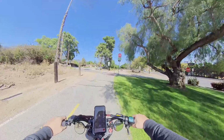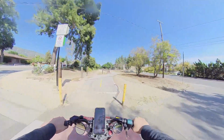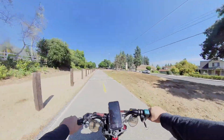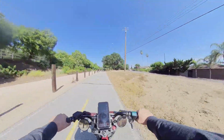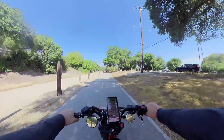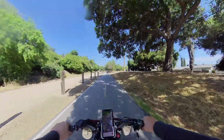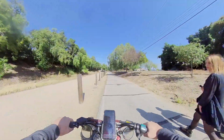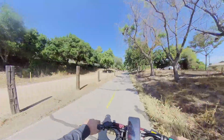This setup was first on my Arielrider X-Class 52 volt. I went around 20 miles testing it on the Arielrider. The BMS on my Arielrider 72 volt battery was only 30 to 40 amp, so that's why I wanted to pair it with this 60 amp. And I think that's what made the 8 mile per hour difference, 48 miles per hour versus 40 miles per hour.